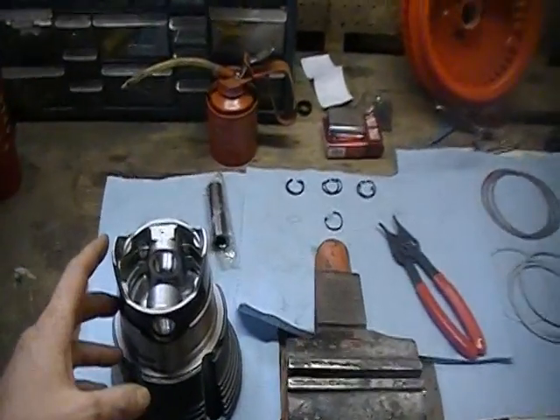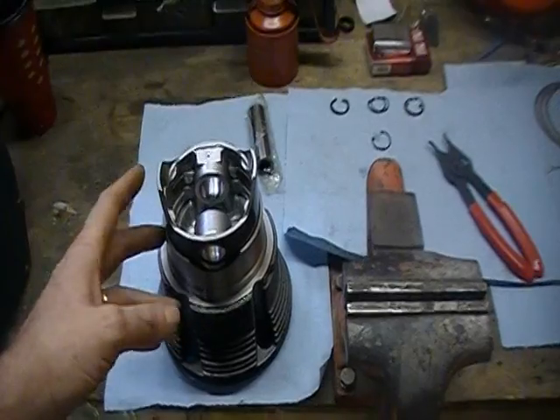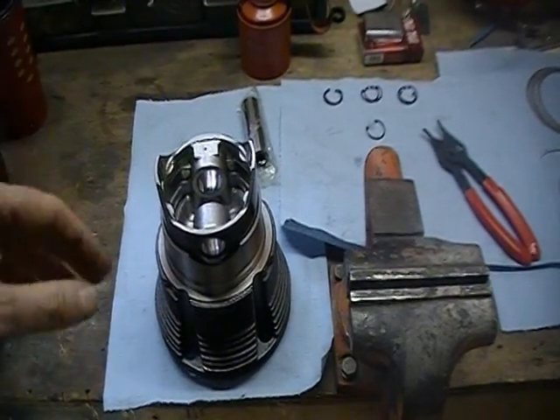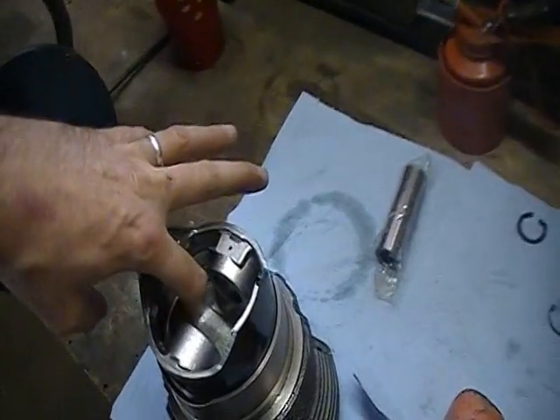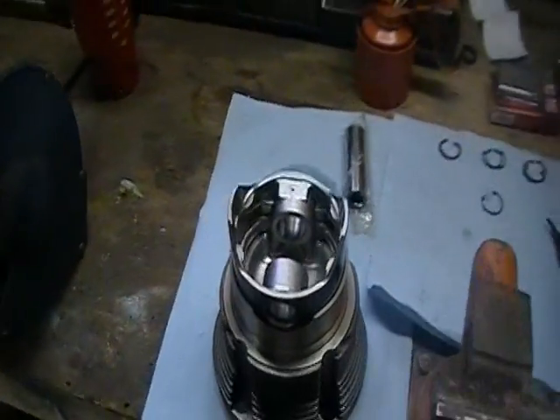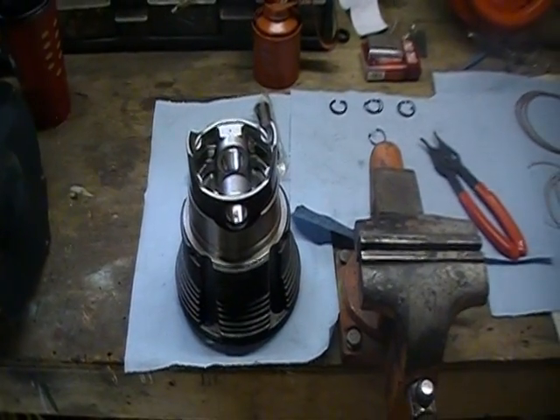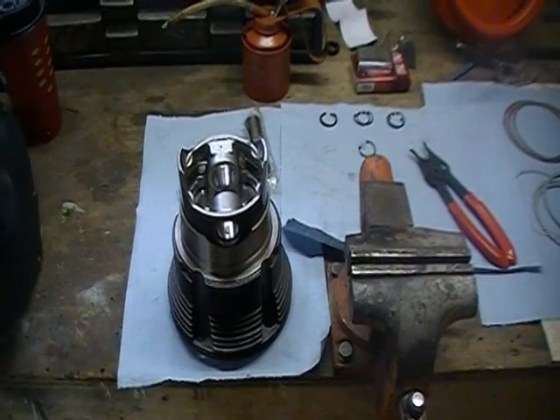With these, you always want to take your pistons out of your cylinders and clean them. I found some little styrofoam bits up where the oil ring groove is. You want to be careful - don't take the easy way out and just install them. Take them apart, clean them, re-oil them, get your ring compressor, and put them back together.